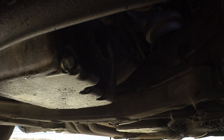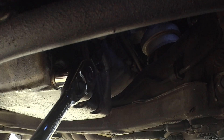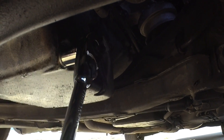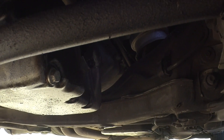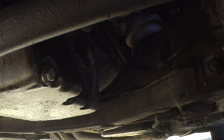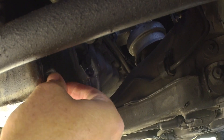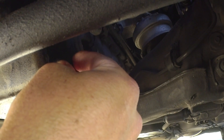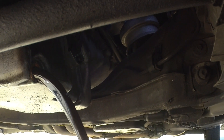With our plastic pan out of the way, we can see the oil pan and the drain plug right here. It takes a 13-millimeter socket. I'm just going to crack it loose. Just got it — broke loose. I'm going to pull this out of there without making too much mess. It's quite a long plug. There we go — mission accomplished.